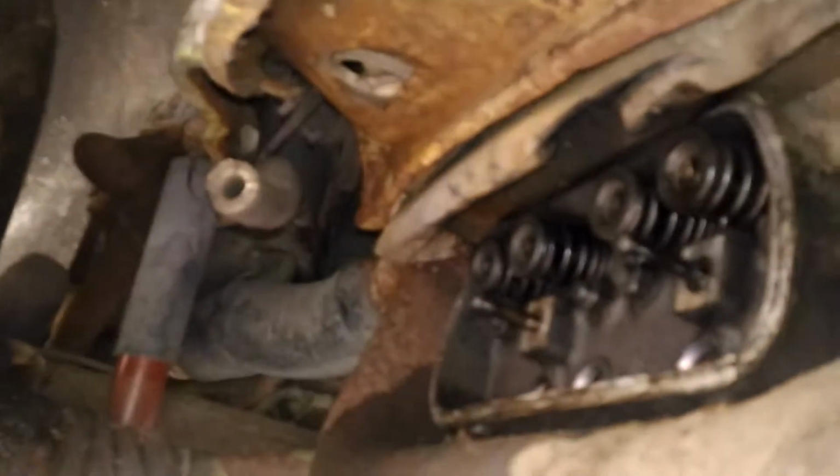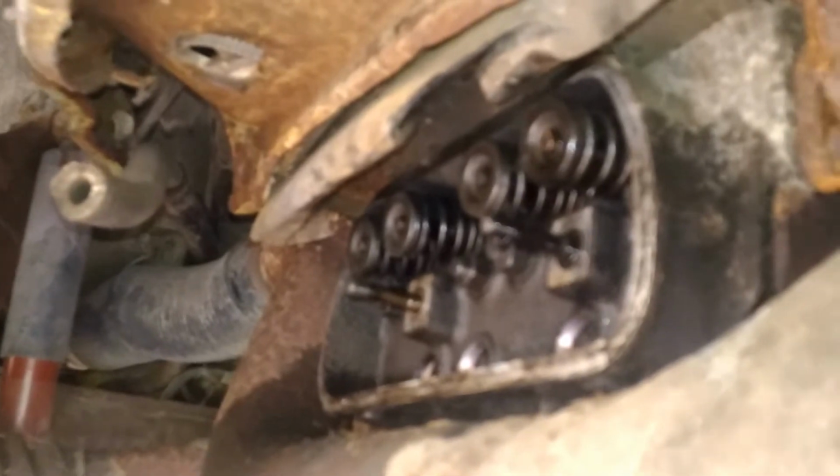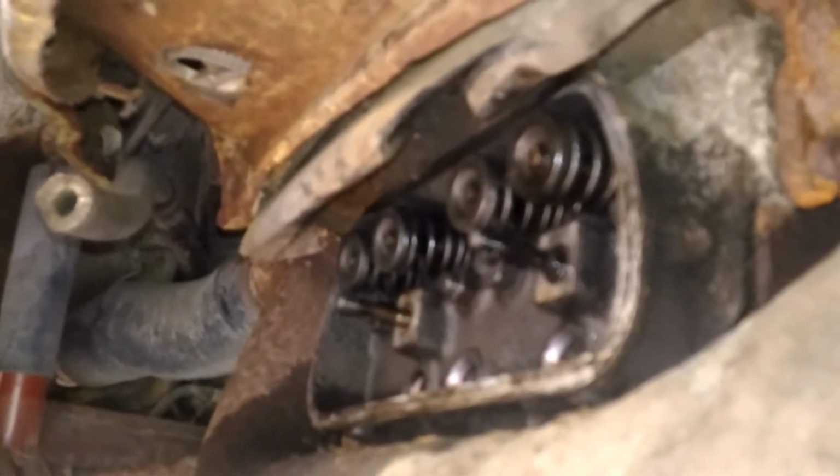Anyway, let's see, I got the valve covers off, rocker arms off, push rods out. I got all the old tubes removed. These plates were real bare to get off. 2 of them. I think I even cracked one. I even broke one of the bolts off, so I have to tap that out, figure out what I'm going to do with that. So now it's open and clear for the tubes.